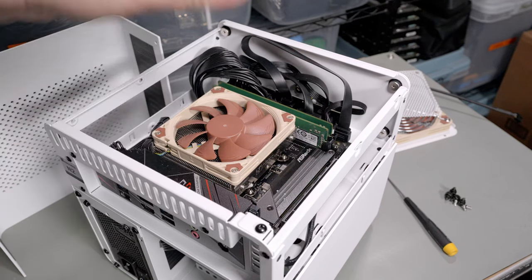Further testing with hard drives: I have five Western Digital Red 7200 RPM 8TB drives in here — they run really hot. At default fan speeds they get up to almost 50°C, which is no good. At 70% fan speed they stay around 38–40°C, which is acceptable, but keep in mind this room is only about 18°C. In the summer in a non-air-conditioned room the drives will probably get really hot. At full speed you can get down to the low 30s but the fan is quite noisy. This is where a 25mm fan would really pay off. With those caveats in mind, I can recommend this case — it's a pretty cool build.